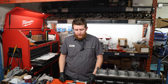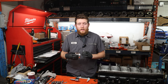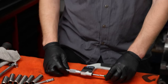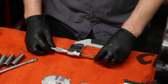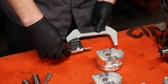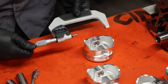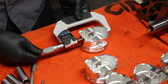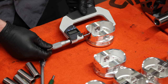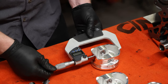We're going to verify piston-to-wall clearance on cylinder one. These pistons were machined to fit each individual cylinder, so I'm assuming there'll be some variance. First thing - always zero your micrometer, especially for such a large item, since the margin for error increases. Now we have our micrometer zeroed, we're going to take our number one piston, go half an inch from the bottom of the piston skirt 90 degrees to the piston pin. I like to grab a measurement, come right off, and then grab it again to make sure you're consistently measuring - four zero two six five.